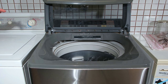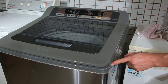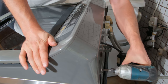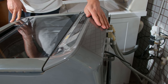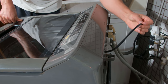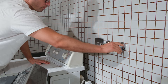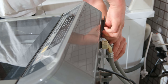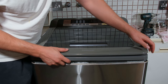There's a screw on each side — sometimes the screw is hidden by a little sticker — and there are two at the back. Because I'm working on the back and taking this cover off, it's worthwhile to disconnect the hoses and switch off the power. I've switched off the power, unplugged it, and switched off the water. I'm just disconnecting the hoses now — there will be a bit of water, that's normal.